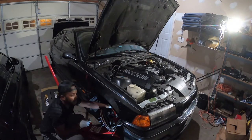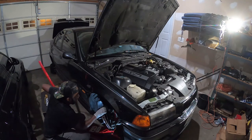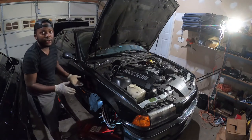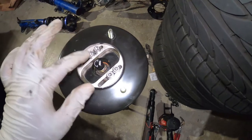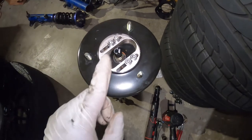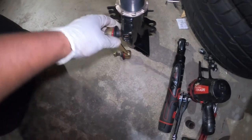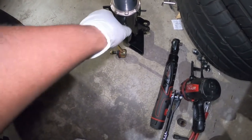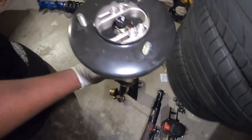Go ahead and raise the rotor just so the brake line is not hanging. I went ahead and adjusted the camber — I wanted the camber to be in the middle. I also mounted the end link, leaving some space so that when I connect it to the sway bar it's easy enough to adjust, and then I can tighten everything later.